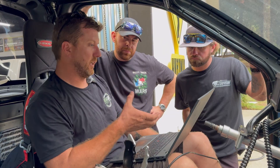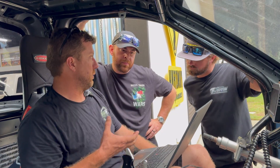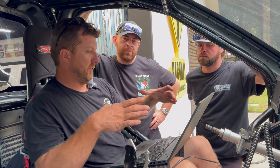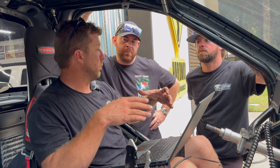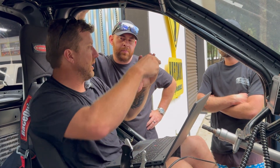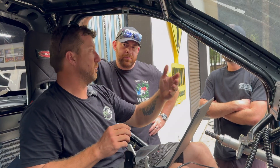You'll find that the more power you make on a fixed-size charger, the peak power comes back and back because you run over it with fuel. A Garrett GTX compressor is not that aggressive, so what'll happen is at 71 pounds of boost you'll start spinning it out and it won't make any more — it's like spinning a boat prop, it can't grab anymore. A GTX compressor is low and has all 13 blades at one height. When you look at a really aggressive turbo, it's a 14-blade design — you can only count seven because the others are down inside — and the ones that stick way up are why it makes pressure.